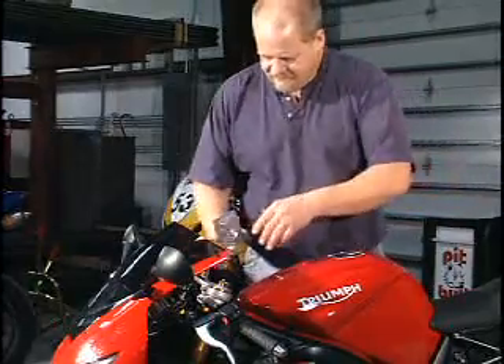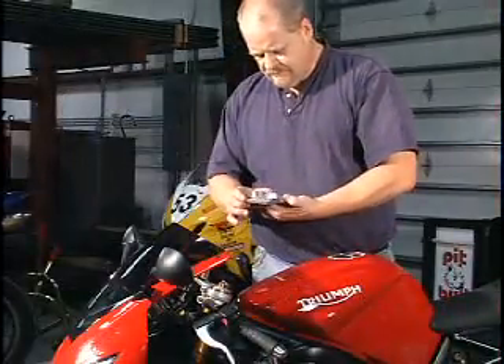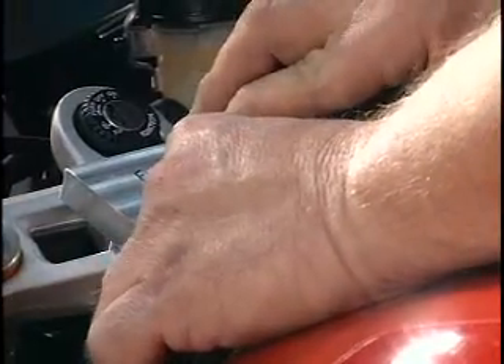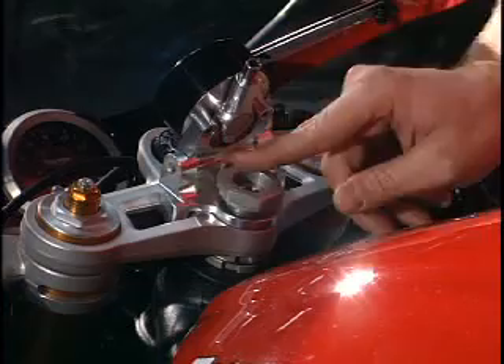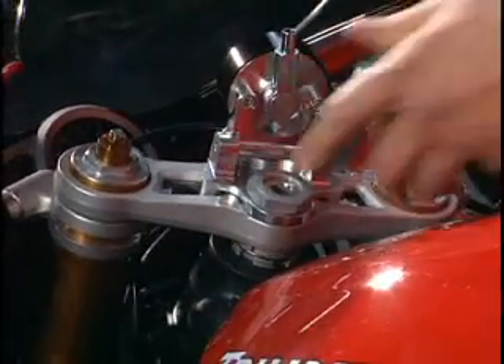While developing the steering stabilizer mount, Charlie and his crew double and triple fit-check an interface plate to ensure a correct fit. The interface plate is just a simplified version of the lower mount system of the steering stabilizer. It's a quick way to get the features that actually interface with the bike so we can do a fit check and then go on to produce the part. The stabilizer mounting system prevents misalignments between the frame and the steering from binding the stabilizer's internal mechanism.